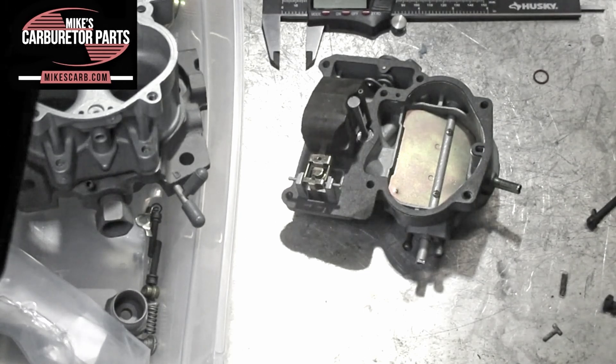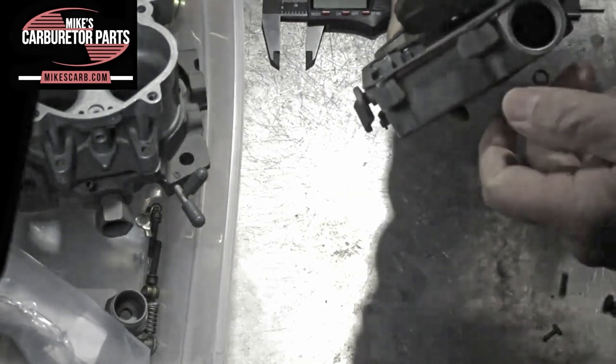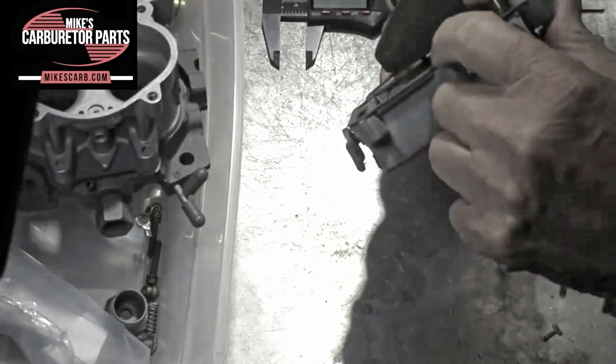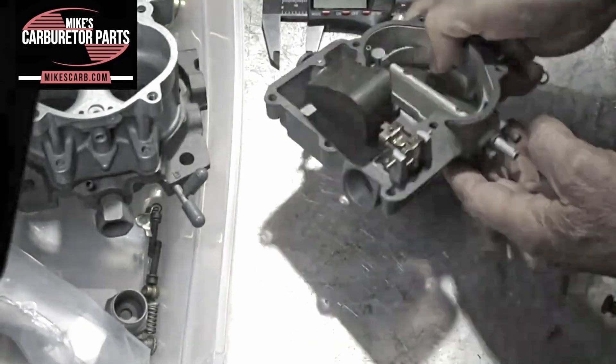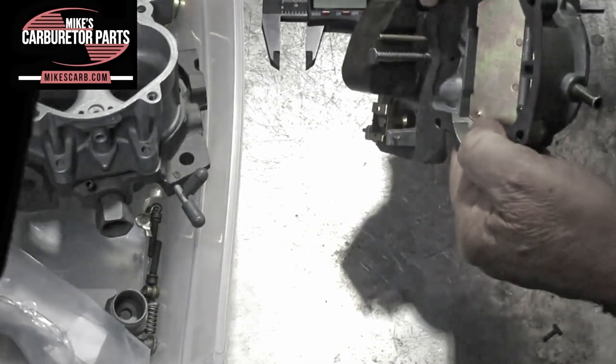The spec varies between automobiles, especially engine size. If you can't find it on the spec sheet, go with the closest spec for your engine size. A lot of rebuilders just set these level — as you can see, it's pretty much level with the gasket. You can do that. As I said, you measure from here up to the seam.